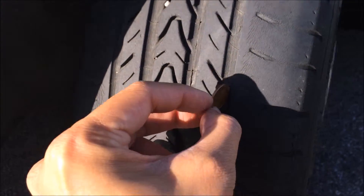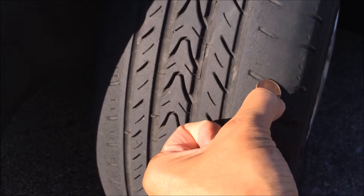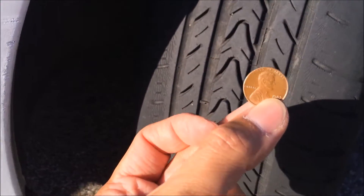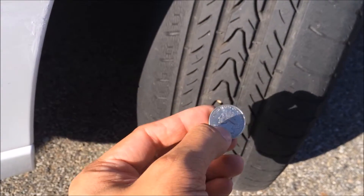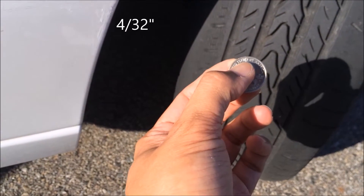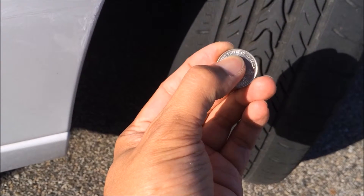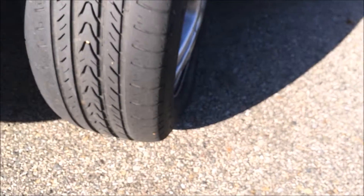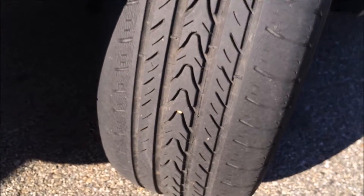You can see there is another point on the side we can't reach because the tread is already way at the bottom, so he's a good indicator saying 'change tire now.' There's also been a movement to use a quarter, which gives you 4/32 of an inch, stating that this tread depth is a much safer level — 4/32 of an inch. That's the first indicator.